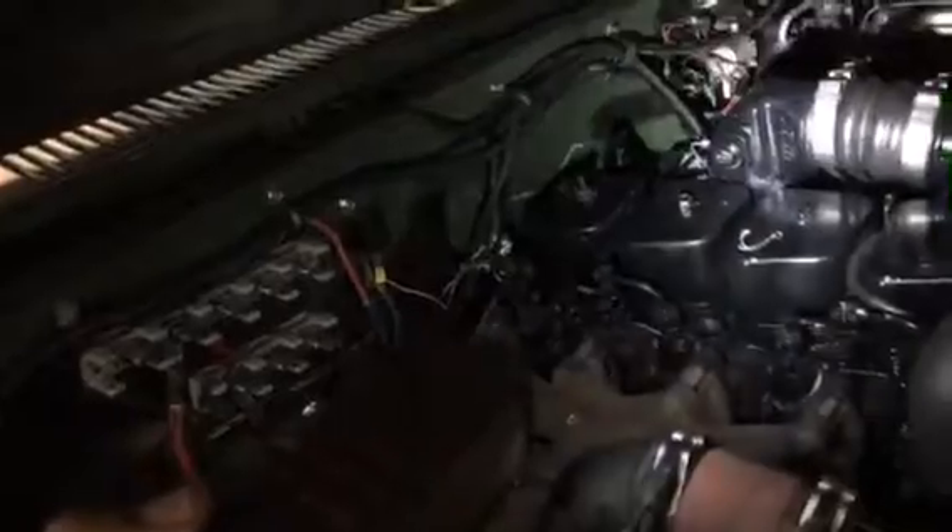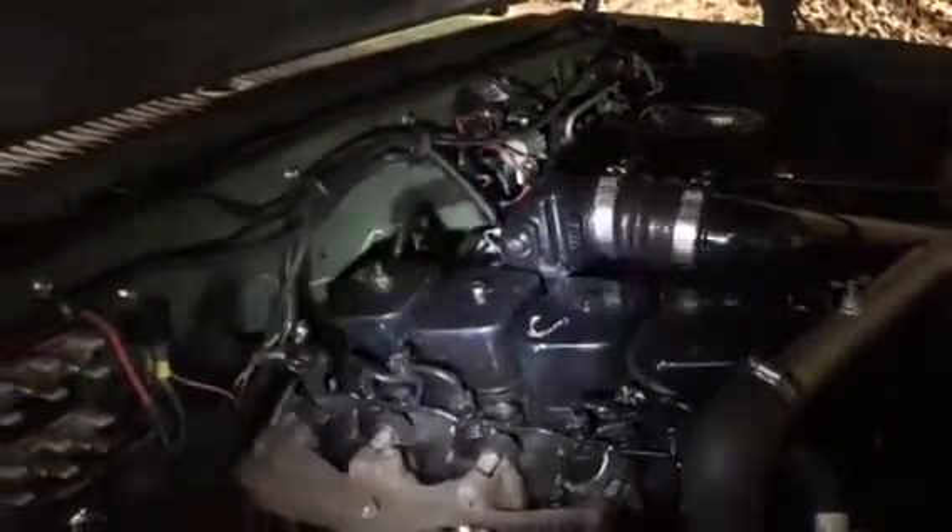The transmission behind it is the Turbo 400, but that 400 is not too happy. I think it's a torque converter not set right — gotta find a lower stall. It shifts funny and doesn't like doing 55. Torque converter's slipping too much, so gotta find a torque converter and add a shift kit into it. Would be nice for a manual but this is just simpler — so Turbo 400.